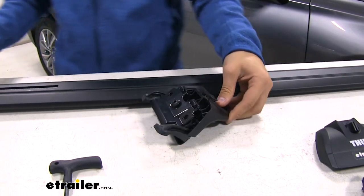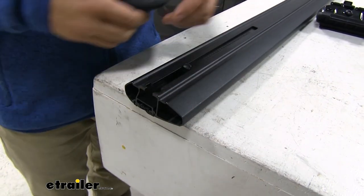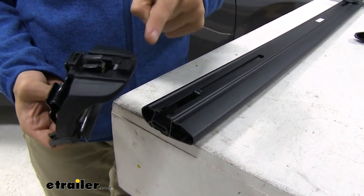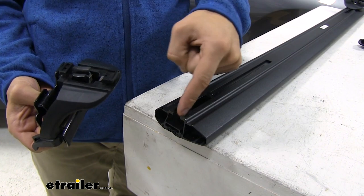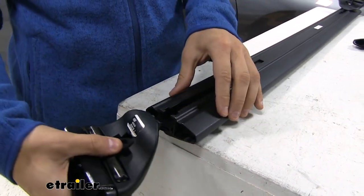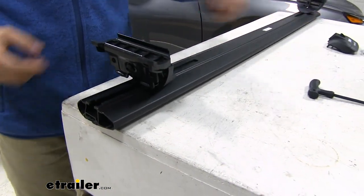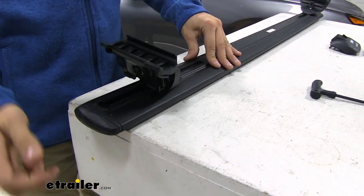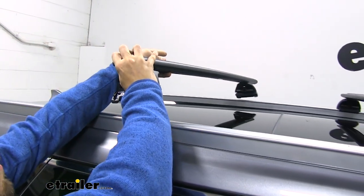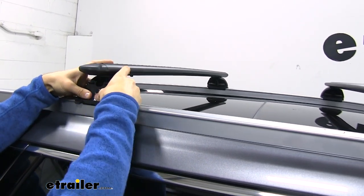We're gonna come over here and take our end cap off by pressing down on this tab. Pull the end cap off. Now we'll take our podium foot with our bracket connected to it. The track right here is gonna go into our channel. Push that back, just like this. Then we'll put our end cap back on. Now we're ready to get on our roof. We'll just reach it over top, get that far bracket on, and then the same thing over here.